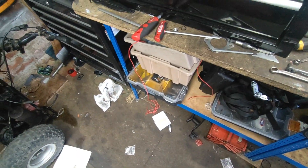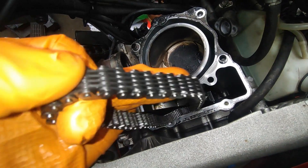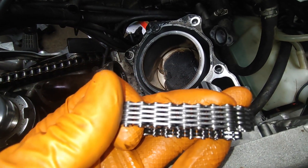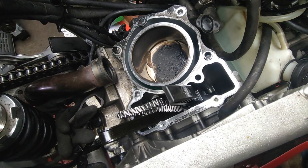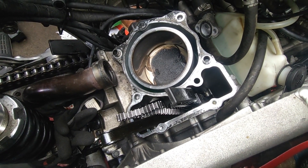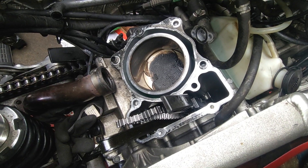These thermostats are expensive as well — about 50 pounds — so I don't think we need to spend any money on that. I've spent the money where it counts, which is the mechanics of it. We've got rid of potentially 70,000-mile stretched cam chains due to the manual cam chain tensioners, so yeah, this is going to be ready to go back together now.